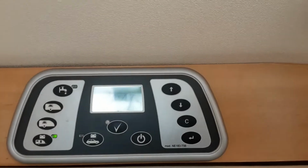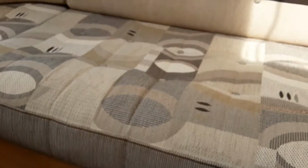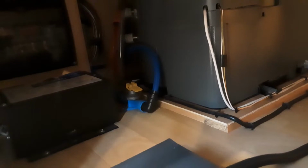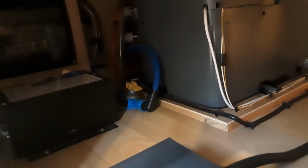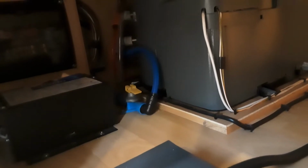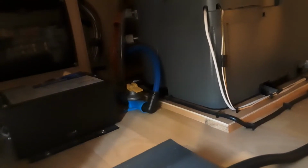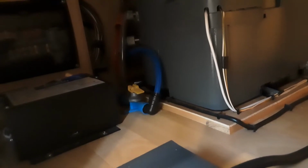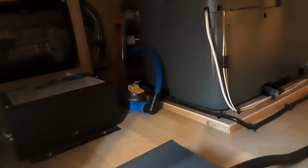First thing you need to do is fill the water system up. So you can come underneath the seat on the front right hand side of the caravan, where we have the yellow drain down valve. The yellow valve is there to fill the water system up and drain the system down. When it's flat with the floor, as it is now, it means you can fill the water system up. If it's upright and pointing towards the bottom of the seat, it means all of the water will drain out of the van onto the floor underneath.